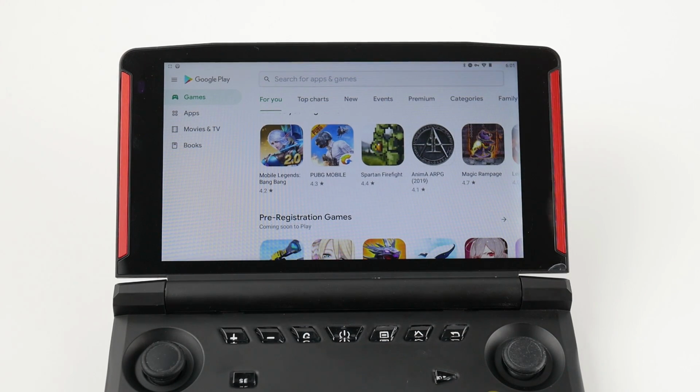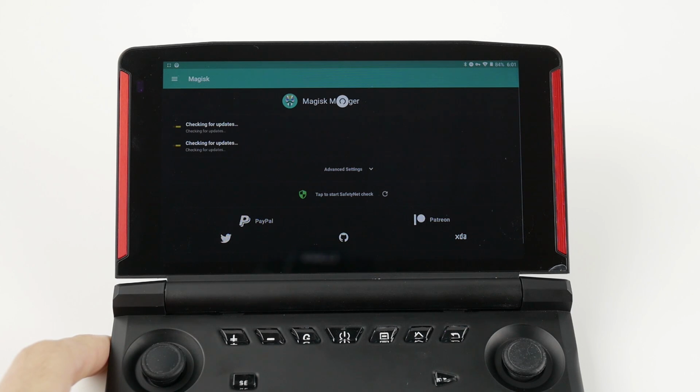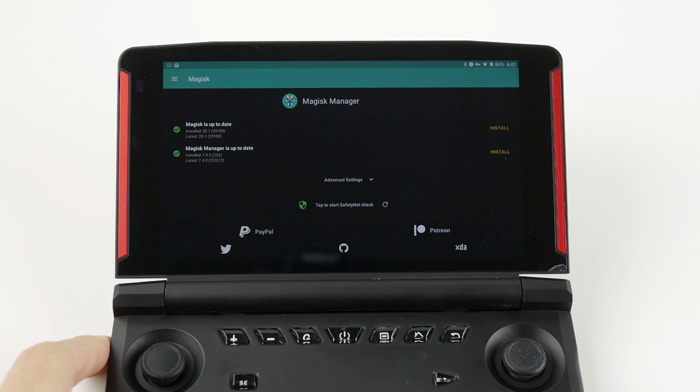I've tried every combination of APKs I could find online, and every combination of Chinese APKs that install Google Play services on MTK chips with no success. During this time, I spent over 3 weeks pleading with PowKiddy to either release the source code for this system or release a stock Android build that we could use in the meantime while we get a development build set up for Lineage OS. All of that back and forth work led to the firmware that you see on screen right now. This system uses a patched boot partition for systemless root.